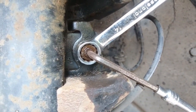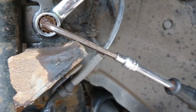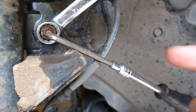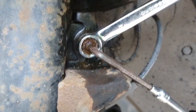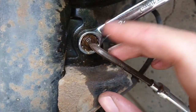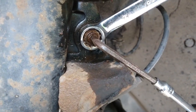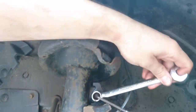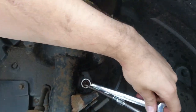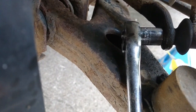So this is the method: 14mm spanner, 5mm allen key, and I use a bar on the end just to give myself a bit more leverage. You hold the spanner in position and work the allen key down. If the thread starts to go tight, just work it backwards and forwards — you'll see all the gunk start coming out of the thread. Just work it gently backwards and forwards; don't rush it or you risk rounding off the allen key.